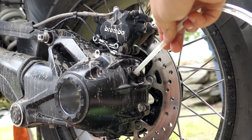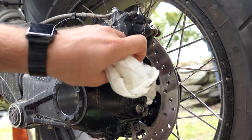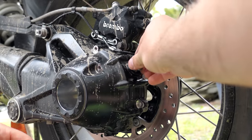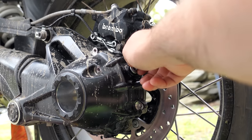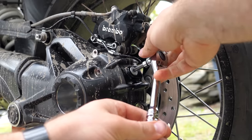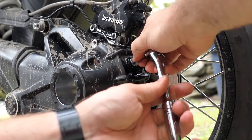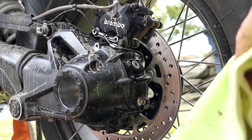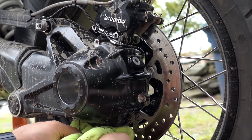There's our 180 milliliters. Take this out of here and use a napkin to clean up any bit that spilled. Put our bolt in. I don't know if final drive oil is as corrosive as brake fluid, but it's not a bad idea to clean all this stuff down after you're done. Use the T40 to tighten things back up. And hit all the surfaces and just clean up all that residue on the top and the bottom now that you're done.